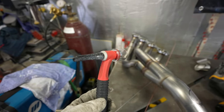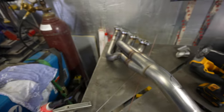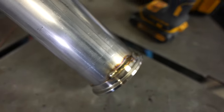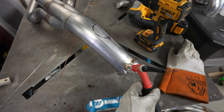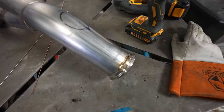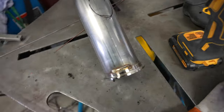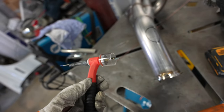There's a new clear cup on this thing - A-plus rated. Busted that out and looking really good. What's nice is whenever you get done welding, if you end right there you still have all the gas flowing all the way back around here so it keeps it really nice and covered. Definitely worth investing in one of these if you're going to do a bunch of stainless welding on headers and stuff.